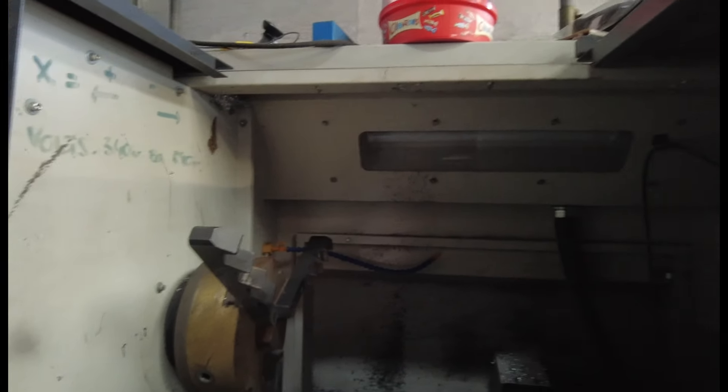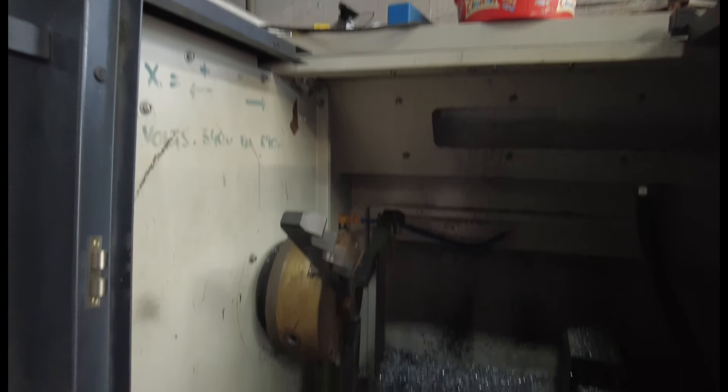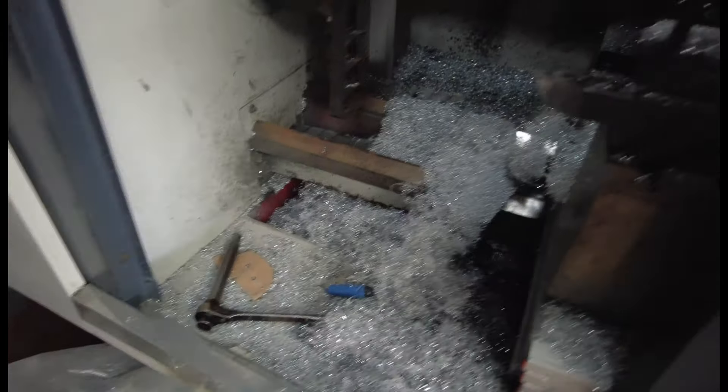So we're just at Park Road Garage now. As you can see they do all the alloys here — they've got a CNC machine for cutting them. That's the machine they use to cut the alloys. They program it up, tell it what wheel is in it, and then it cuts your alloys and you end up with this nice little swath. They also powder coat your wheels here.